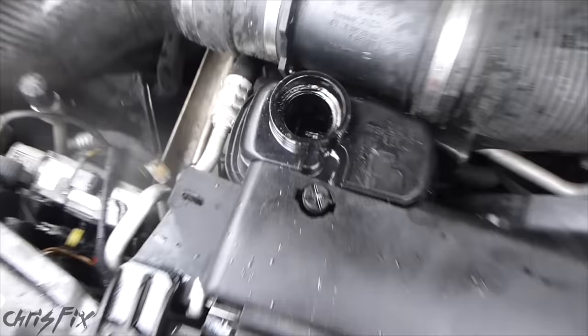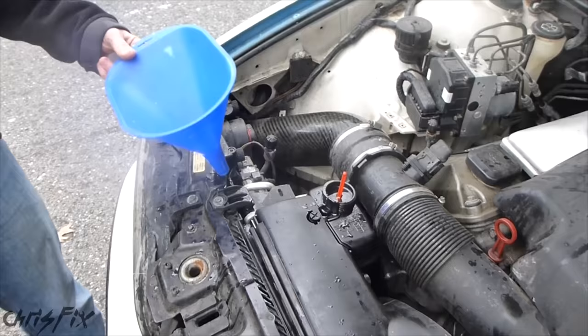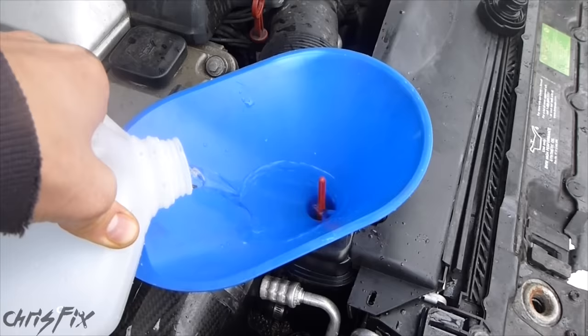On this BMW, we're going to fill up this reservoir here with water — you can see it's emptied, so just get your funnel. This system takes three gallons. After you fill it up all the way, go start your engine. With the engine running, add the rest of your water. The water pump will suck the water into the engine and radiator, allowing you to fill it completely so there's no air in the system.